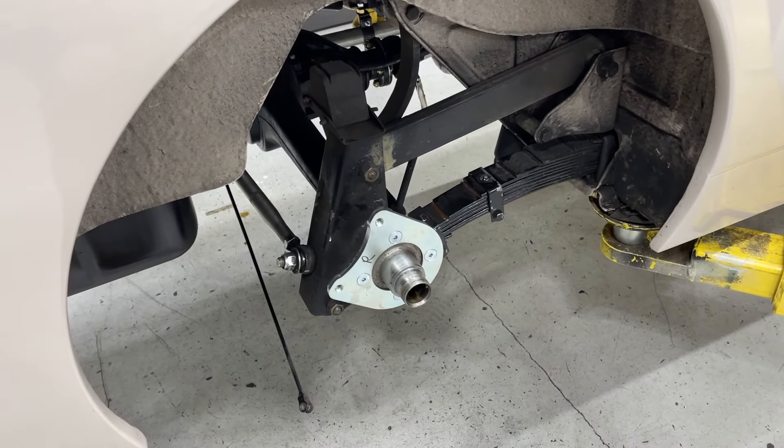You'll notice the rear spline under here — this is the spline drive for wire wheels. You're switching from a bolt-on configuration; you're still using this hub, but the bolt-on setup uses four studs, while the wire wheel uses a center drive spline pressed onto the axle. If you get the long ones from us, they come this way. There is a bolt-on wire wheel conversion, but we're not super fond of that because we've had a few come into the shop loose. This is a much safer system — it's a very popular request and we're really happy to have it available.